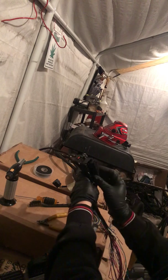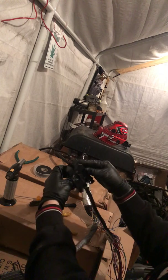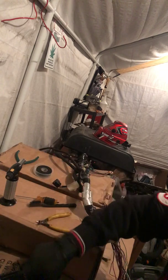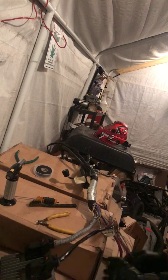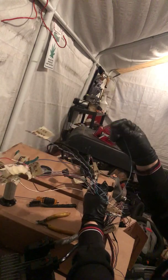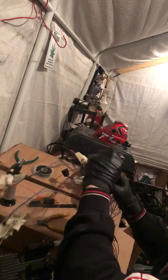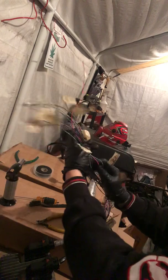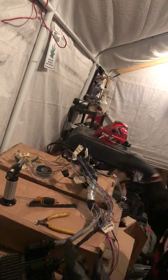Once we do all that, we cover it back up. Now we're going to be left with a bunch of things to deal with. The gas pedal for the LS3 is actually electric, so we're going to have to rewire all the connections that go to the actual accelerator pedal. I'll do an update once I implement all these cables and terminate them onto the gas pedal.